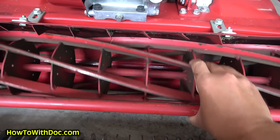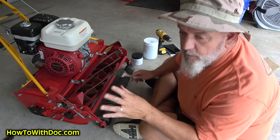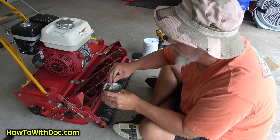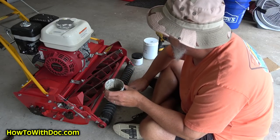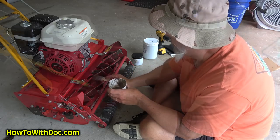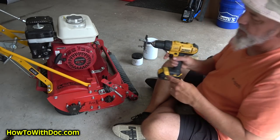So as you can see this side piece — my reel is floating freely. If I don't loosen all three it's not going to do that. When I back lap, my blade is going to rest nice and smoothly, freely on its own all the way across that bed knife. Tip number one: wear safety glasses when you do this. So this is 80 grit and I'm just going to go all the way across my blades — every single one — I want to make sure I get the corners. You don't have to get it completely covered but get it pretty much on there on all of them. I will put a link to this tool.